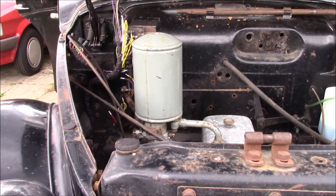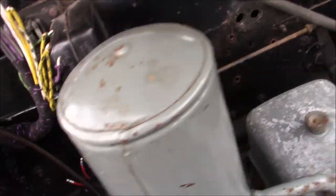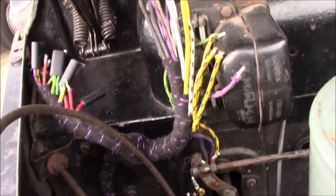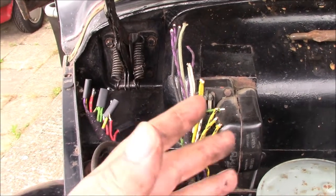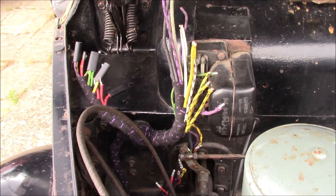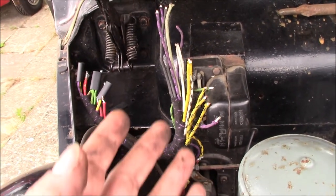The wiring route's changed again and there's a good reason for it - there's a lot of trial and error in this job. I've got those wires back through where they go next to the screen wash bottle. I had to pull all that out again and then re-thread it because I'd threaded these through from the inside of the car to the engine bay - you're actually supposed to go the other way. It's still just as difficult to do but if you don't do it this way around, the wires aren't the right lengths where you need them. It's not by much but it's by enough.